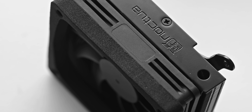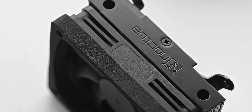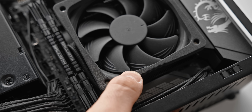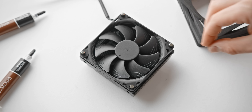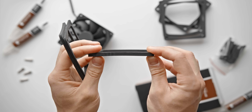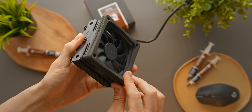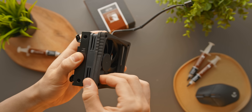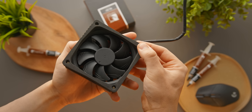The material is a reasonably dense EVA foam, very similar if not identical to what Noctua coolers actually come packaged in. It's forgiving enough to provide some compression, but dense enough to create a nice seal. Installation is also super easy. First, you need to replace the fan screws with the taller hand-tightened ones included in the box. Then work out what sized foam spacers you'll need with some quick math and trial and error — take whatever cooler height your case supports, subtract the cooler height you're installing, and then add a couple of millimeters to whatever is left over. For our Dan A4 SFX, I found that 12 millimeters in total — stacking the 7 and 5mm pads together — gave me a completely closed seal against the side panel without any bulge or pressure.